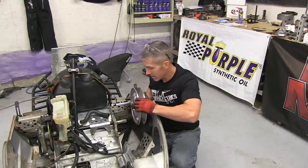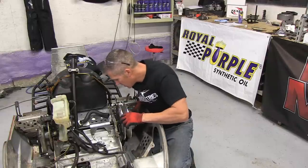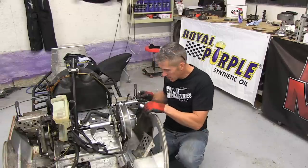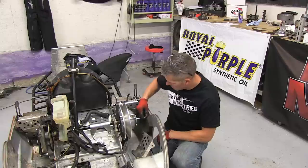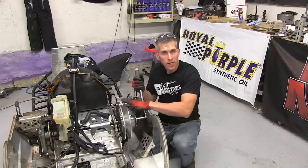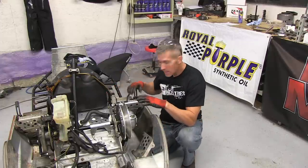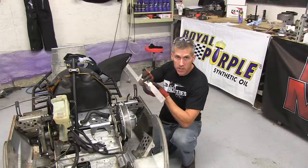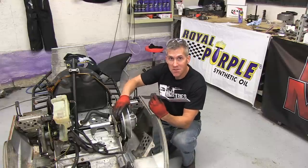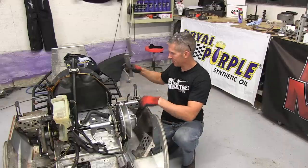The instructions are very detailed. Now we just install our retaining bolt and tighten that up. Before we do anything else, we need to check the clutch alignment. I don't have my engine in yet, so I can't do it right now. Keep watching — we'll get her done.